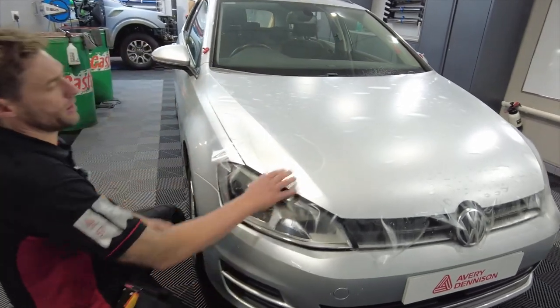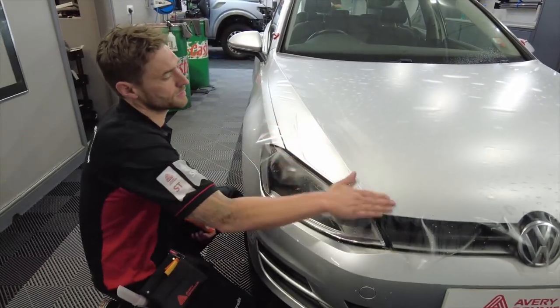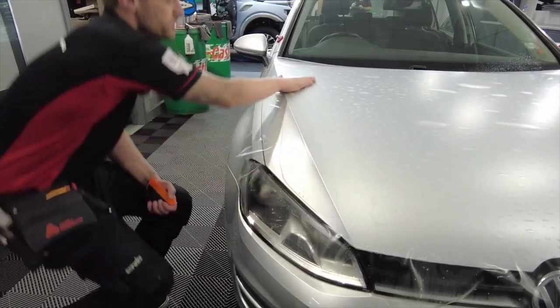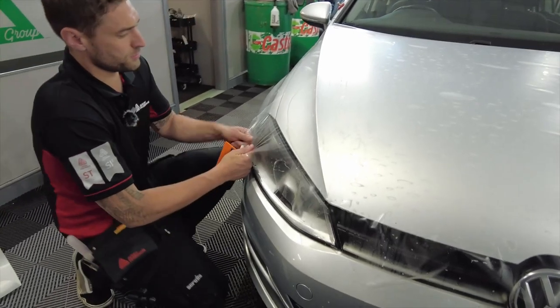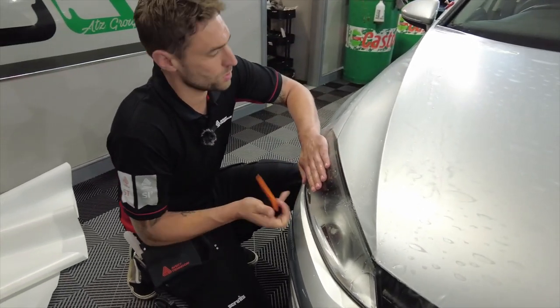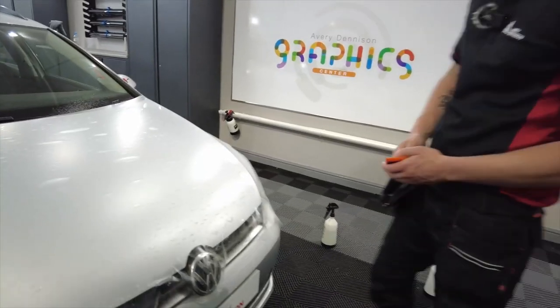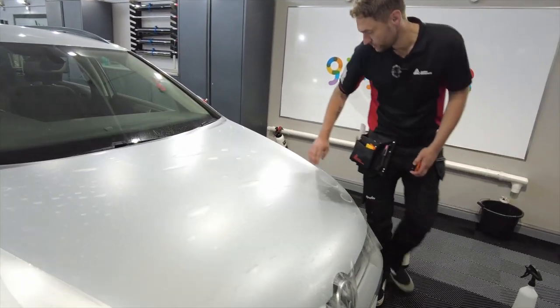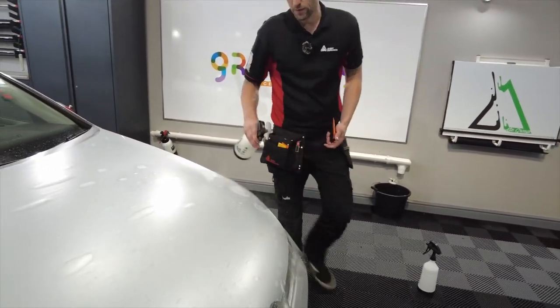You can see I'm just sliding the film around — I haven't actually squeegeed the face yet — so we can just slide this water around and make sure there's plenty of moisture. I'm just tacking it off the panel to make sure we've got a nice even spread of tension. You can see there we've got no real big fingers on any of the edges, which means now we can just spread it around and start squeegeeing the film down.